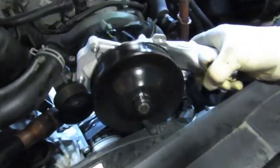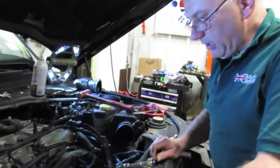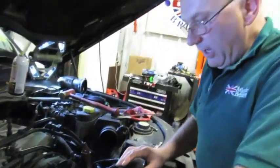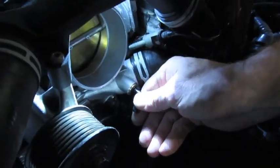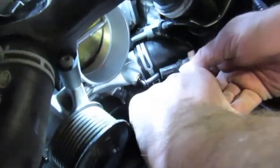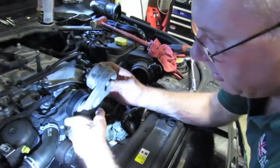For the install of the new water pump, slightly lower it and locate it into place — it can be a bit fiddly. Tighten it up hand tight initially so everything is comfortably fitted to the engine, then do the final torque, and reinstall the coolant hoses. The plastic elbow for the small bypass hose literally just pushes into place — spin it to the right orientation, and then the old hose is gently slid back over it.